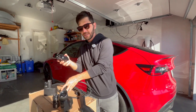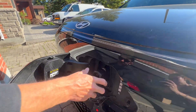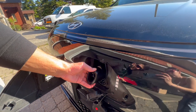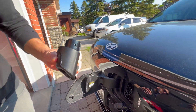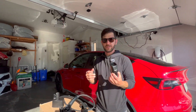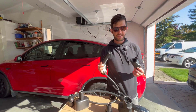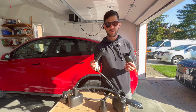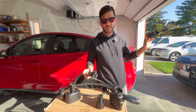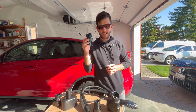So this part just pops into the top here, and now this becomes a NACS-capable car. There's a release mechanism to get it out. The reason to have this is that there are hotels and parking lots that have Tesla destination chargers, or maybe you're going over to a friend's house who has a Tesla. If you have one of these, you could charge your CCS car with it. These are very inexpensive and highly recommended.